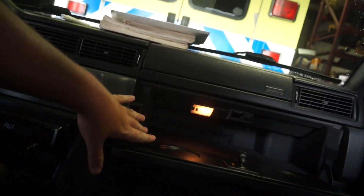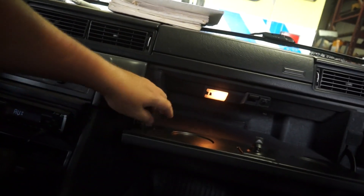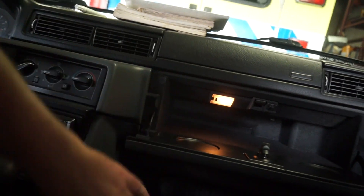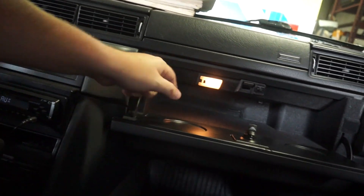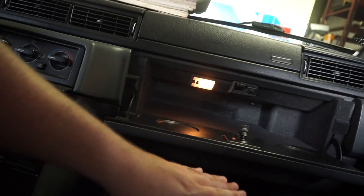How do we do this? Pretty simple. Your blower motor and your blower motor resistor sit inside your glove box. In order to do that, you need to take out the glove box and, typically speaking, your knee panel down here. There's also going to be a brace that goes in there that you've got to take out as well. I'm going to start doing some disconnection and take it apart, and I will walk you through that process as we go.